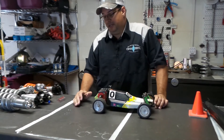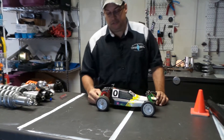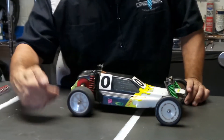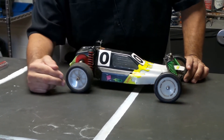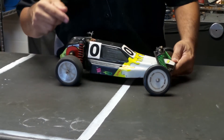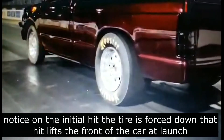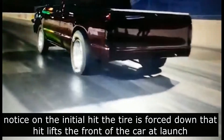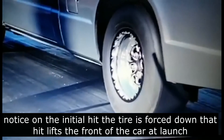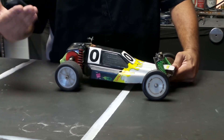The second reason you want a double or triple adjustable shock over a single is for acceleration — important for drag racers and autocrossers. When you go to accelerate, they always call it weight transfer, but it really isn't. On a drag car you'd see the tires wrinkle, but on a street car with a radial tire, when you first take off the rear end gets pushed down a little bit. You turn your rebound up to keep the rear end from pushing down as much. Then as it comes out of the hole, you may get rear tire hop — pop pop pop pop.